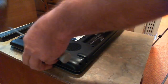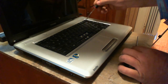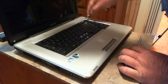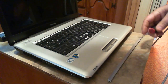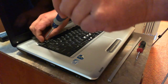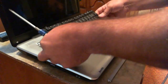Now we'll flip the laptop over, open the screen, and remove the keyboard - it's a very simple thing. By the F11, F12, F4, F5, F1, and by the Pause Break screen, there are little tabs. You can get your pick or use a small slotted screwdriver, work it up and pop it out. The pick works easiest I think. There are only two screws holding the keyboard in - you want to do your best not to lose them, they're little screws.